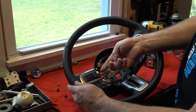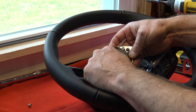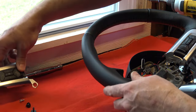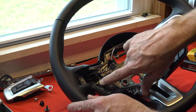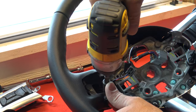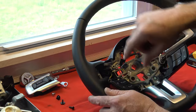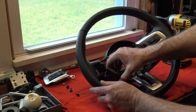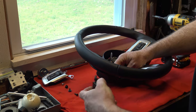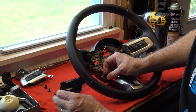On one side, I would suggest sticking your finger under there and popping it up. There's another plug with a pushpin — press down and pull the wire out. I'm putting these on a workbench in a certain order to try to keep them organized. Then we have that one screw that was not visible until we removed the bezel — take that one out next. Be careful not to over-torque these as they will break the plastic tabs. Once this one is out, flip it upside down and stick your finger on the tab to get it to slide loose — it has a pushpin there, but it can only go in one way.